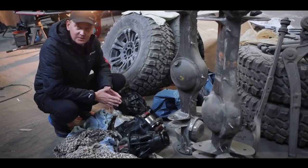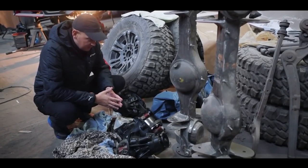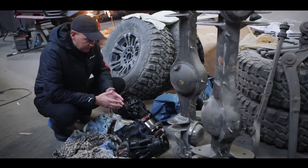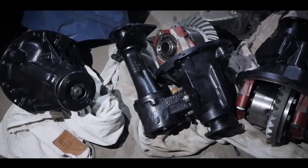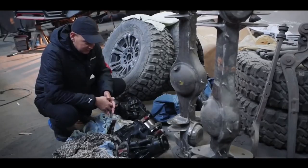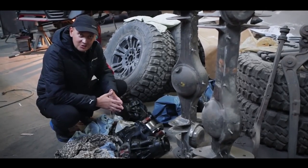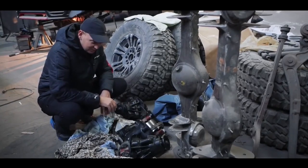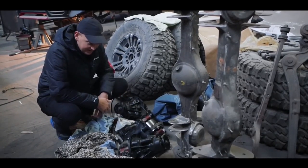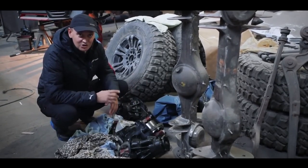We have taken our reduction gears from the specialists who made the main ones. What did he say about the settings? He said that they were generally good, but it was quite hard to set them properly. There were some problems with micro washers. In general, he set them. So there is a good point that he fully disassembled the reduction gears, so we got an opportunity to sandblast and paint them with powder. We don't usually do it because there are lots of bearings and I don't like when they are heated, due to the problems it can cause.